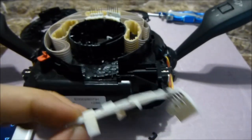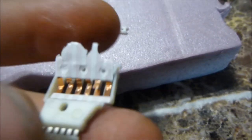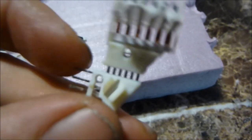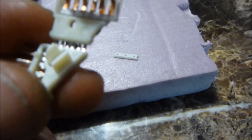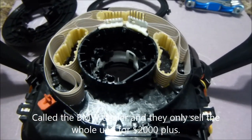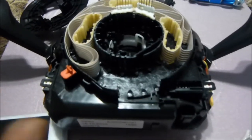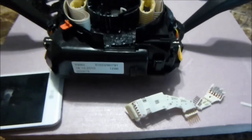I took the plastic piece off the top to see how the ribbon was on — it's actually gold-plated or copper, and it's soldered to the connection. That's going to be quite difficult to repair because of the sensitivity of how it's mounted. So I'm going to try to locate a new or used one, or find replacement ribbons. I found one on eBay for about $190 for the whole unit from a four-cylinder — I think these are all interchangeable. That's what's wrong with it: ripped cables.